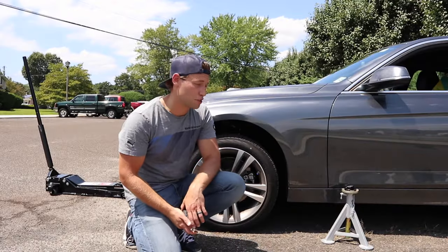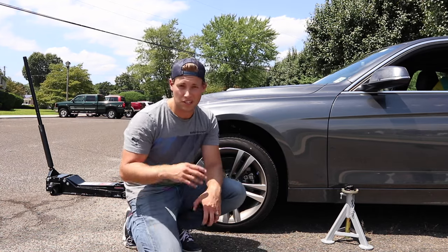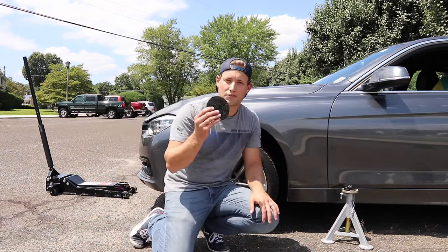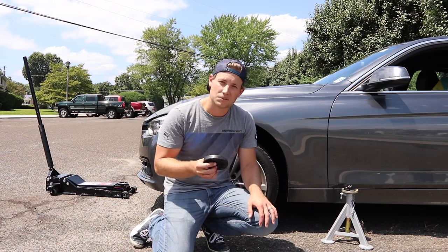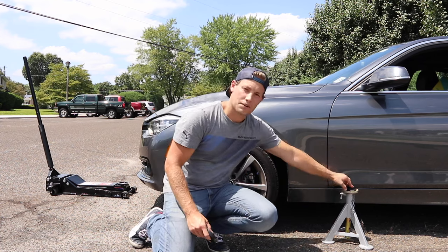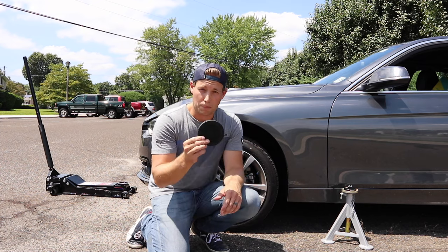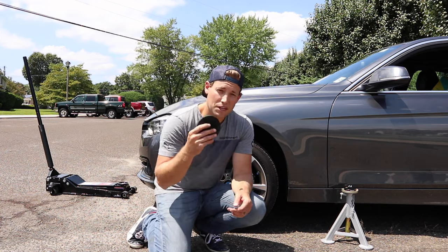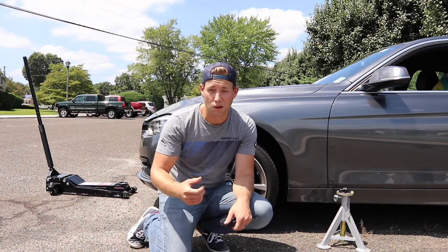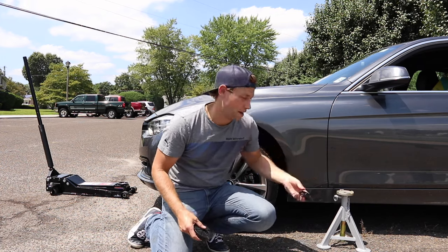We are ready to start jacking up the front of the vehicle. When you're doing this, it's very important — you never want to have metal on metal. You can use a towel, some people use a block of wood. I actually, when I got these jack stands, it came with four rubber pads. I prefer to use the Burger Motorsports jack pad adapters and I cut the protruding piece off the rubber pad and I'm going to use that rubber pad to jack the vehicle up. Slide it under, make sure you have it in the right spot, and then slowly start to jack the vehicle up. You don't want to keep your vehicle suspended on one jack for long, so make sure you have your jack stands ready on both sides of the car with the jack pad adapters.